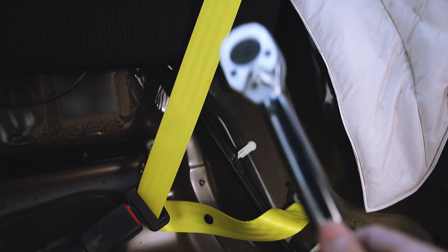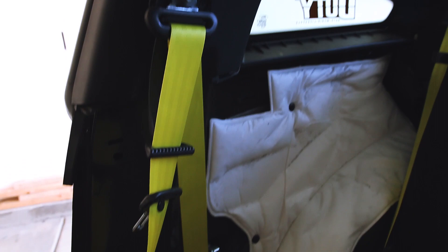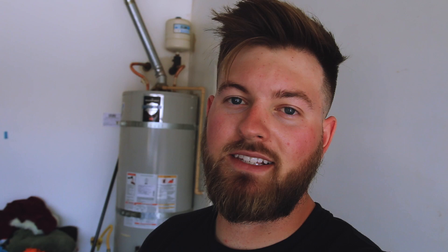You can start to click it in and that's kind of an idea of what it's gonna look like. I'm gonna use my torque wrench set to 30 foot-pounds and move on with the interior panels. The passenger seatbelt is in there looking great. All the electrical connectors are reconnected. The SRS torque specs are 30 foot-pounds for the lower, 30 foot-pounds for the mid, and 35 foot-pounds for the upper hex. All the Torx are 30 and the hex is 35.